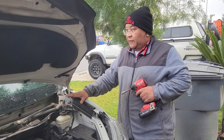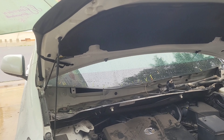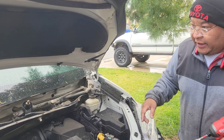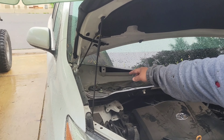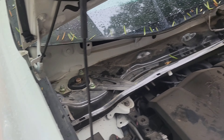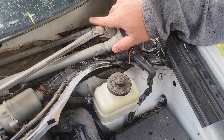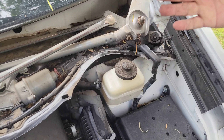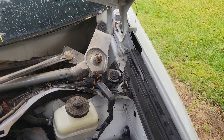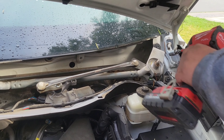What we've done so far is we've removed the plastic covering here. We have to do that in order to get to the strut tower. The strut tower is right here underneath the plastic shields. On this side, this is the windshield wiper motor and all the doodads that have to do with the windshield wiper. So we're going to remove this contraption here.